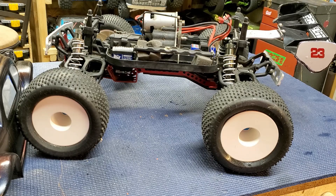Future upgrades for this truck — I believe this truck is going to get the brushless system. We had alluded to maybe putting it in the show truck, but that truck doesn't need a bunch of horsepower; all that's going to do is tear up bodies. So I may put the 775 and the EVX2 in the show truck and put a waterproof SC8 Hobbywing system in this one — maybe with a 2650, or if I want to get real nutty, a 2200 on 6S. I'd really rather not run this truck on 6S — it doesn't need to be any faster. The handling just isn't there and the wheelbase is way too short. On 6S, all you're going to do is either break drivetrain components, because it's still got plastic gears inside the transmission, or it's going to do backflips.